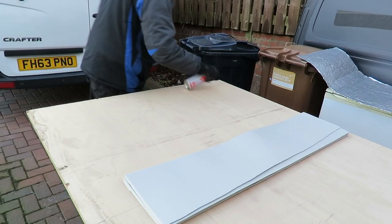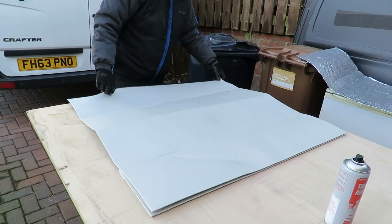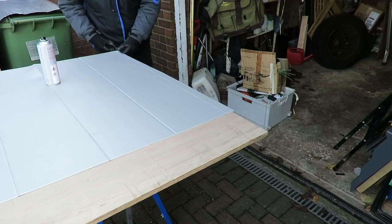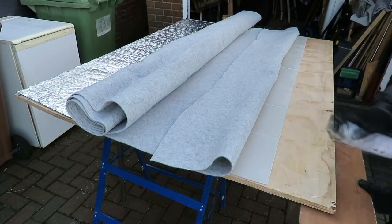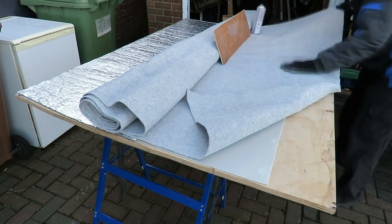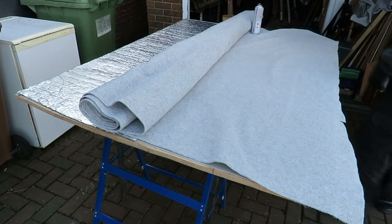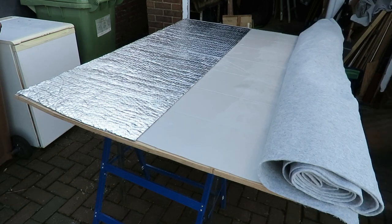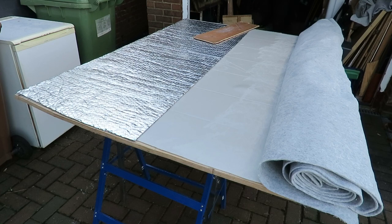So that's the wheel arch covers done. Now we're going to do the bulkhead. I was going to build one with foam inside, but it was going to encroach on the cabin area far too much, so I just used 18mm ply. I had some laminate underlay lying around so I put that down and coated it with some Reflectix as well, then glued the carpet onto it. I'm just smoothing it out, trying not to stretch it and getting rid of any ripples. I worked my way up, and when I got about three quarters of the way up I lost the footage — anyway I just worked my way to the top, flipped it over and did the same on the other side, then trimmed off the excess.